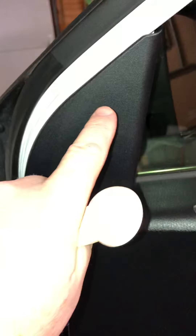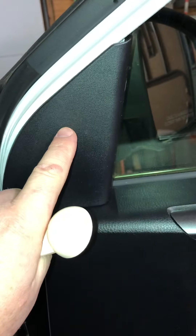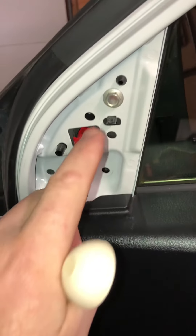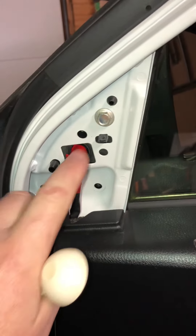The very first thing is there are three bolts in here that hold that mirror on, so you've got to take this cover off. We're doing this one-handed, so we're using plastic so you don't scratch the paint. The cover comes off really easy — just work it down. It's easier with two hands. That gives us three 10-millimeter bolts.